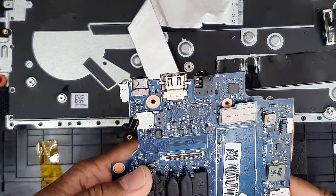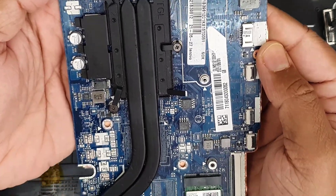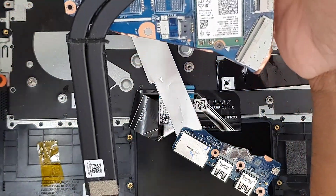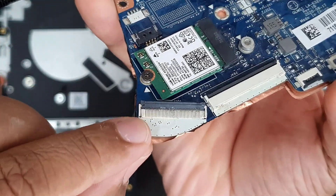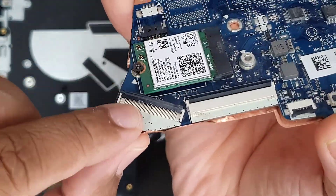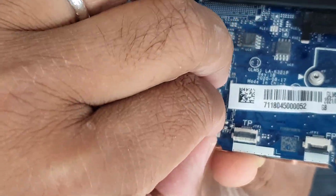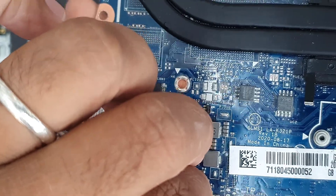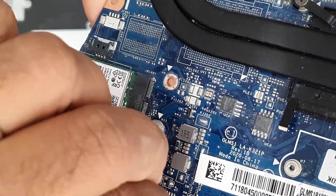Check all the connectors. Nowadays most laptops have a power button on the keyboard — that could be another reason why it doesn't turn on. Here we go. I can see on the power button connector some sort of stain. That is definitely from the liquid.